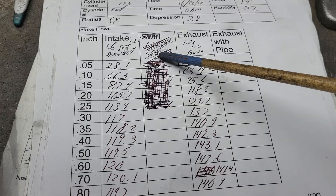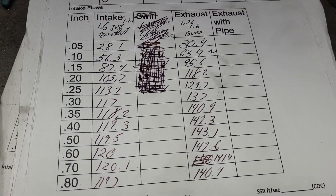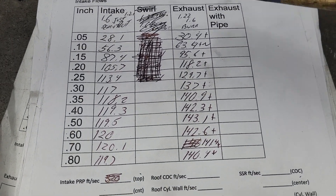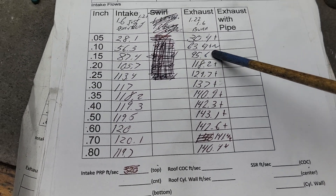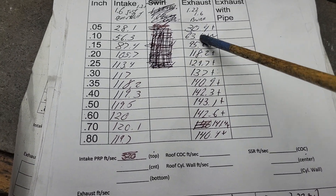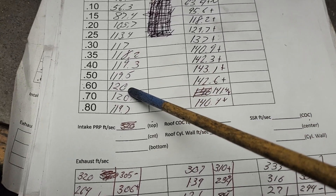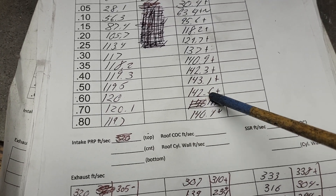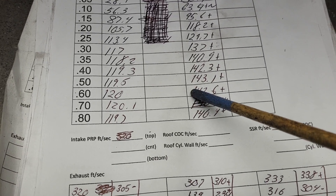So what did we do? This was just the seats, and this is a quick radius. As far as straight flow, we're better everywhere. We do have some noise around here that we didn't have on the original — good to notice. Now we topped out at 120 before, and we picked up 20 or so CFM just by doing that radius and having a super tight throat.